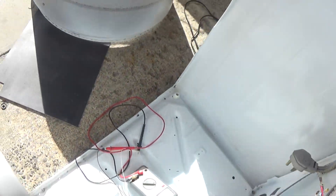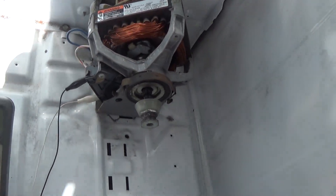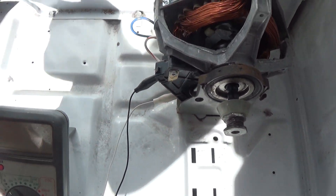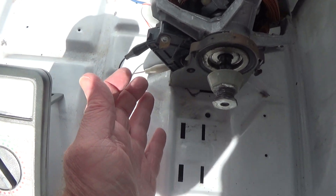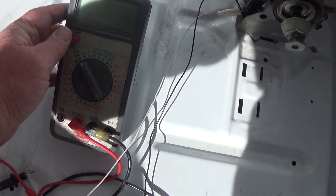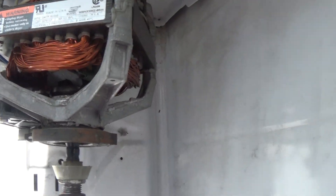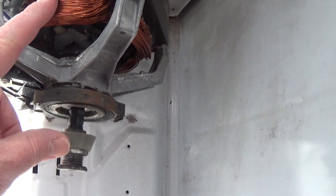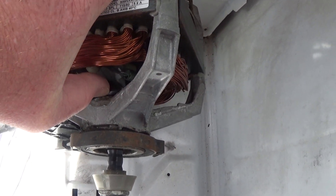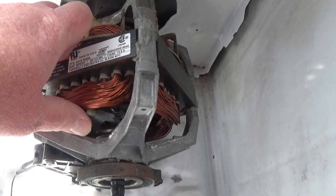The way you test that out is — looking at the dryer motor — you can see I already put alligator clips on the two outer red leads. If I had the connector plugged in here, you'd see the red leads around the ends. So I just hooked that up, and I put it on your meter on continuity, and mine's got an audible, which is nice. Then you just come over to your dryer, and when the dryer is spinning, it's got magnets on it and there's a little plunger. So you just reach down and I'm going to push the plunger to the back, and you can hear the meter go off. And if I let go of it, it comes to the front.